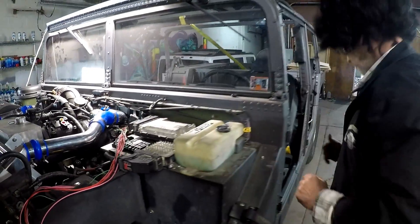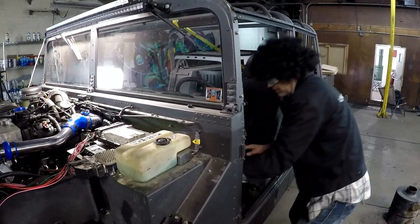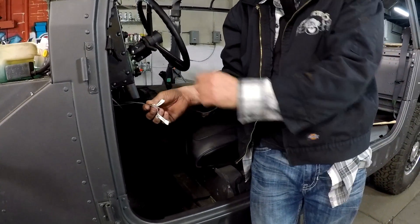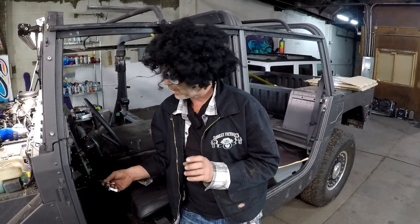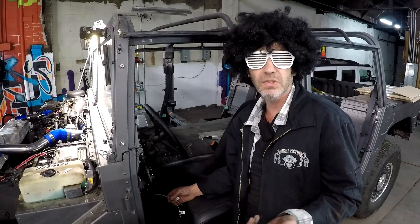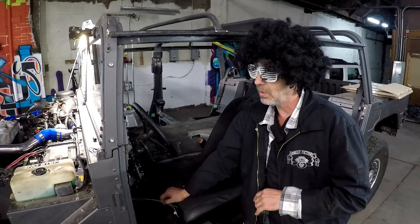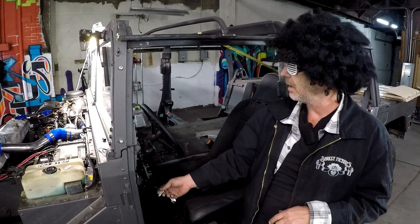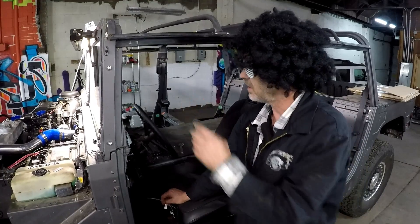On the electrical side there are also a couple wires that you'll pass through inside the vehicle — what we call your CAN wires, 2500 and 2501. Those go to a DLC port that we supply. That allows you to plug in the handheld tuner that we also supply. It communicates back to the engine, allows you to remove the security, set your performance level, tire size, and all kinds of stuff. It also lets you diagnose the vehicle — you could plug the tuner in and see codes like a P700, which is a transmission fault.